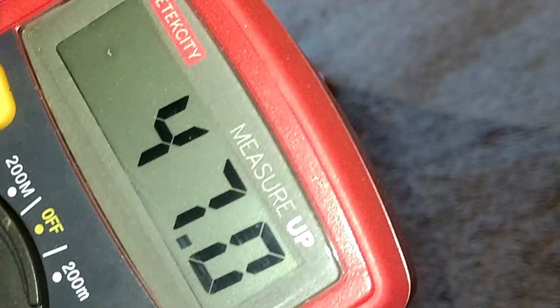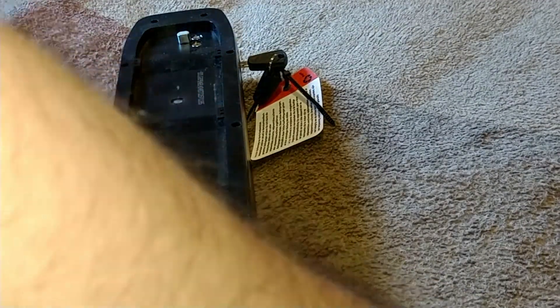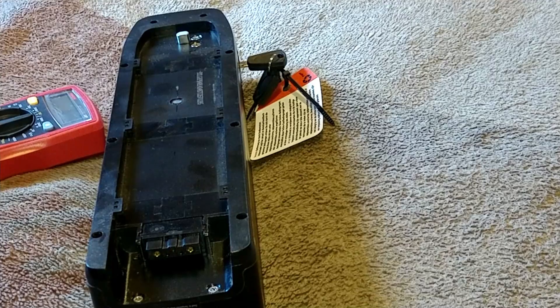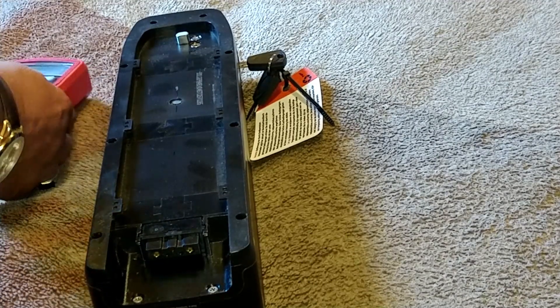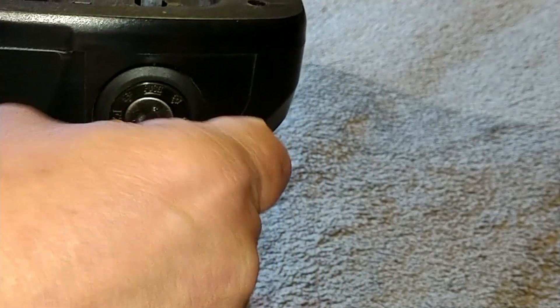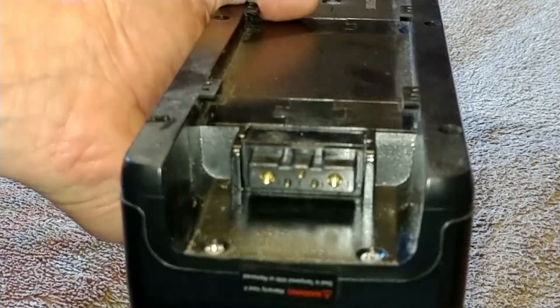We've got roughly 47 volts. The battery fully charged is going to be about 54.6 volts. This is also another way to check if your meter readout is right on your bike and if maybe you're having some problems with your charger. The bike readout showed three bars — well, that's not really accurate, because the bike only has five bars and at 47 volts you are pretty much down at least 50 percent. Do not base your travel ability on that little power bar — you could end up stranded.